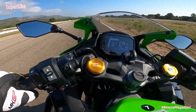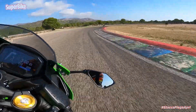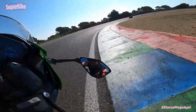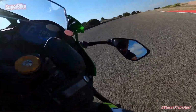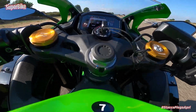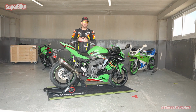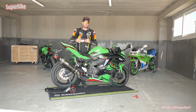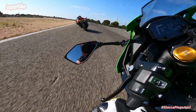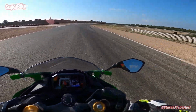Below 6,000 RPM, this bike could be said to almost not exist. Indeed, in reality, considering the well-matched gears, as soon as you start, you are already over 6,000 RPM. From 6,000 to 8,000, 9,000 it tends to be a bit lazy. It's an area where you shouldn't stay if you want to go fast, especially on the track. At 8 to 9,000 exactly, the pace changes, it begins to pull, it starts to roar with aspiration, to sing through the exhaust, and then it's the high range where the beauty and the actual push come. Sure, we're not talking about Superbike.